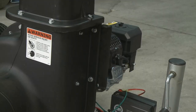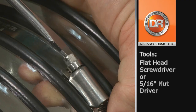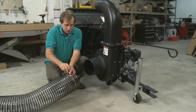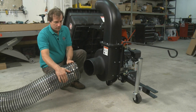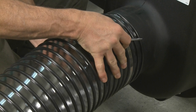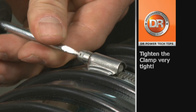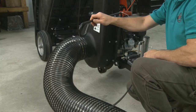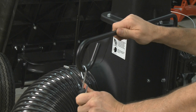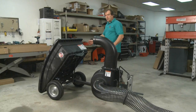We'll insert the hose support into the impeller housing bracket. Next, we'll install the hose onto the impeller housing. First, you'll have to loosen up the clamp just enough so it will slide over the housing. One thing to remember: the hose clamp needs to go on the housing just past this nub, which will help to hold it on. To install the rubber strap, we insert one end into the hose support, loop the other end under the hose, and back up through the hose support.